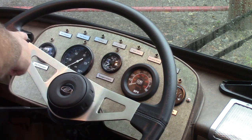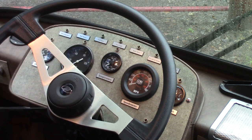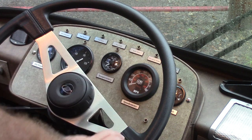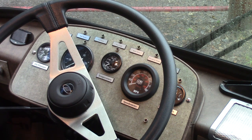The gauges are: oil pressure, air pressure — that's for your brake systems and all of your air systems on the bus — temperature, speedometer, and fuel level for the diesel. Down here are two other indicators for your tag axle air, showing that you have air to both of your tag axles. You can turn those off and raise them up to put all your weight onto your drive axle if you want. If you turn those off, it'll indicate that you don't have ample pressure in your tag axles.